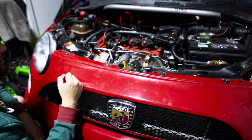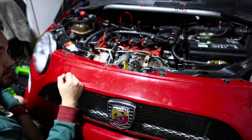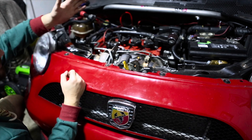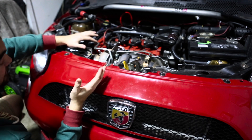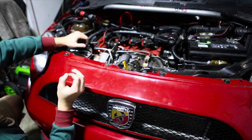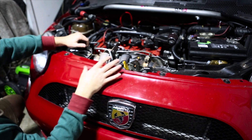That's pretty much where it's at now — everything's pretty spot on. Boost hits around 3,000 to 3,500 RPM. There is a minimal boost lag, especially if you're in fifth gear — you've got to downshift to get up there again because the computer freaks out if you push down the gas pedal in fifth gear because you're lugging the turbo, which you shouldn't do anyways. Other than that, the turbo's spot on. Everything seems good. It runs a little hot, so we're going to bend some stuff out here just for the safety of other parts like fans and things like that.